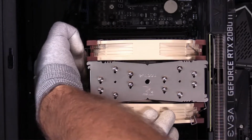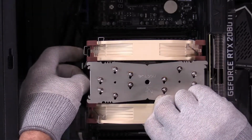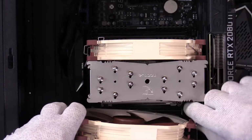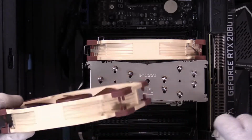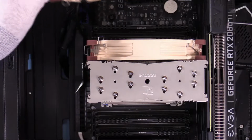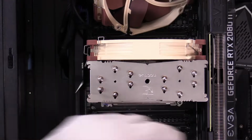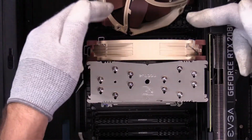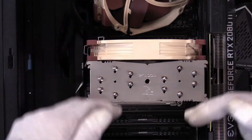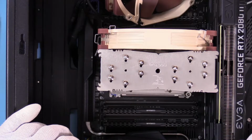And on this other side here on the left side, I can pull this off in a conventional manner. Okay, fan is out. And I'll have to reverse that procedure to get that in there correctly. So I'm not going to disconnect the fan from power. My goal is here I want to get the RAM in. I've got 2 sticks. Those are open. So this is reversed. These 2 sticks over here need to be put in first, then these 2. But since I'm here, I'm going to work these 2, then I'll work those. And see if we can do this without having to pull the video card out.